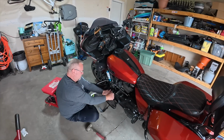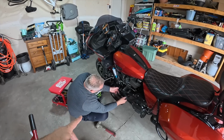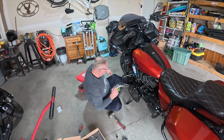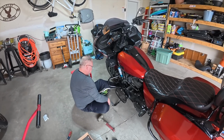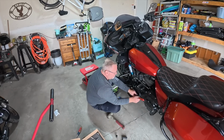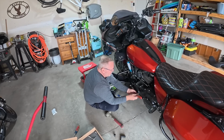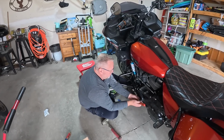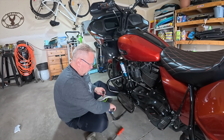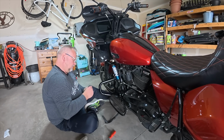Yeah, I mean, that's the crazy thing about these bikes, just the air cleaner. Now we've got the 511 cam in here, which is awesome. But I told Nate, there's a bunch of other cams. You can go as crazy as you want, but the power difference, even in just the slip-ons and the air cleaner, was awesome. And that 511 cam is so nice. It's so rideable and still has the power. Whatever cam you buy, you want to buy the one that's for how you ride. Don't worry about the highest horsepower, unless you drag race.